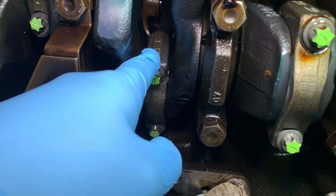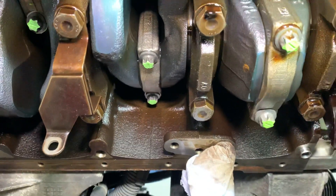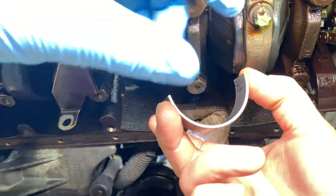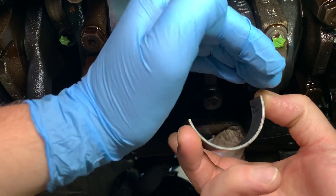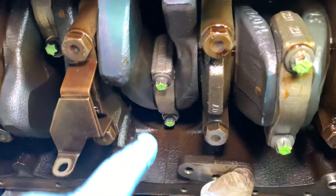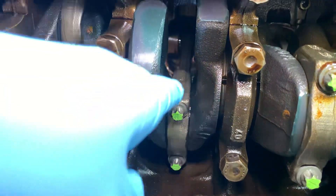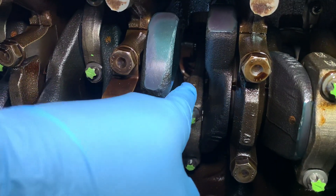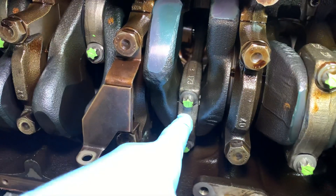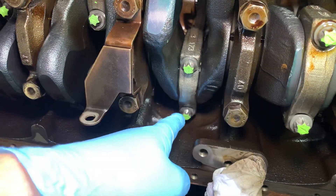Down here is nicknamed the big end of the conrod and this is where the conrod bearings are stored. They're semicircular — there are two halves that make up one full circle bearing. Although the conrod looks like one piece, they're all made up of two pieces with an invisible join line just between those stamped numbers. The upper part is known as the conrod and the lower part is called the cap, held together with conrod bolts.